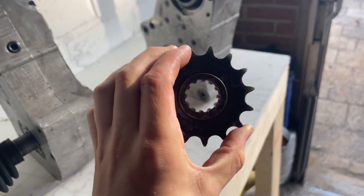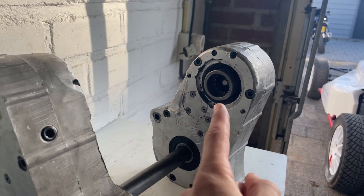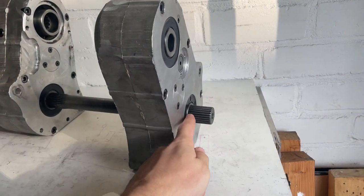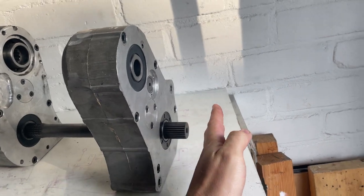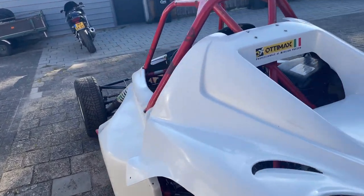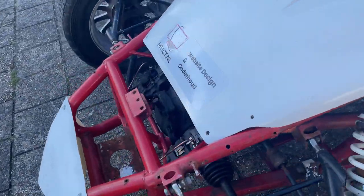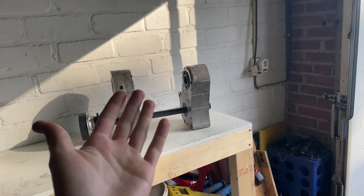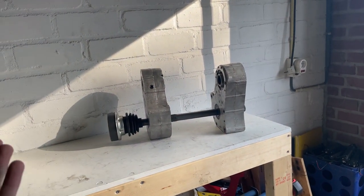This solves our problem of the engines spinning in opposite ways, and it will be fairly easy to connect because there are splines in the middle over there which connect to the engine where the sprocket normally goes. I have the sprocket right here, and it's the same spline pattern that fits in there. Once I have the other CV joint that goes on this side of the axle — which mounts the rest of the drivetrain and goes to the front differential of the car, right there — we can fully install this gearbox, mount the engines to it, and we should have drive.